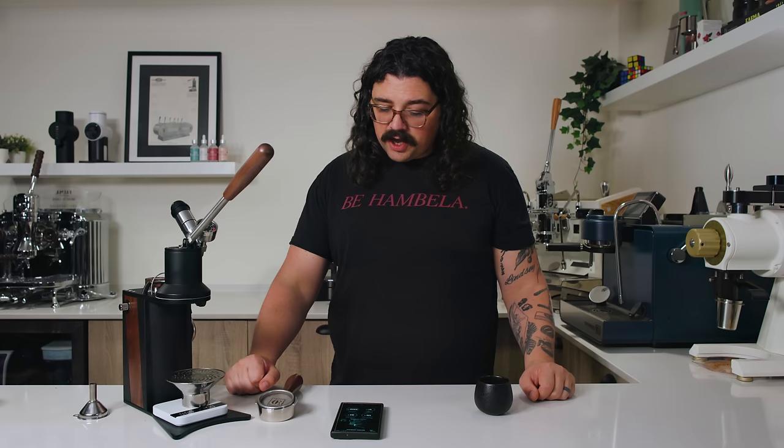So you see immediately on that screen recording that the red has increased greatly, because now it's not worried about the brew group temperature. It's worried about getting the steam temperature up. It's worried about getting the pressure up to a capable pressure for steaming. So it's going to do that as quickly as it can.